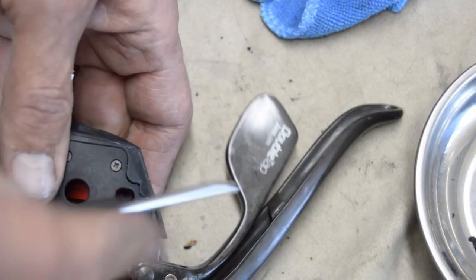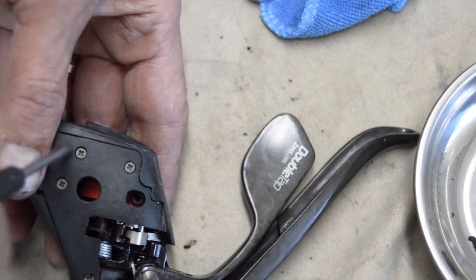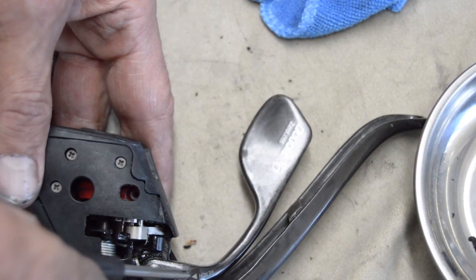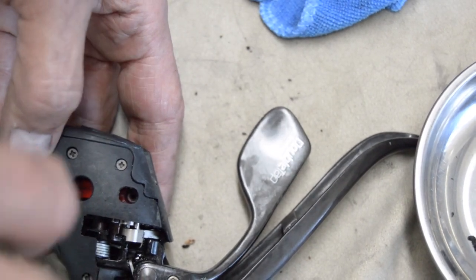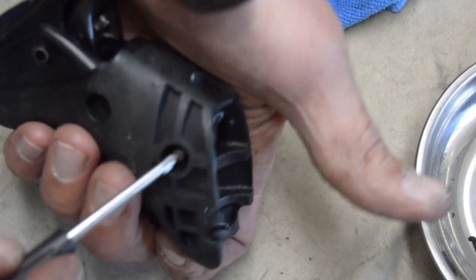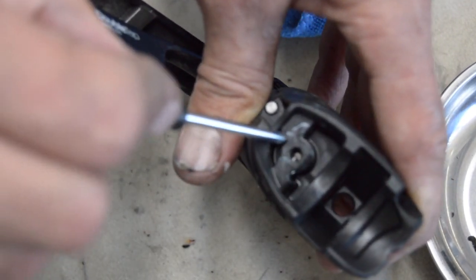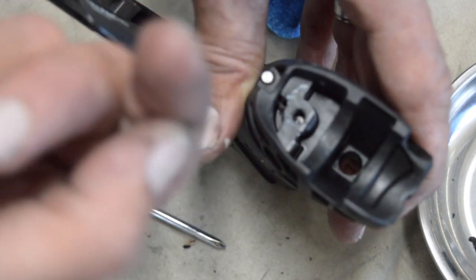You can see on the shift lever that gap in between — that's where we can make our little adjustment for shift lever reach. Get these snugged down, and the other screw to hold that pin in. As I snug that one down, you can see it protrudes just past the pin — it doesn't rest against it, it just holds it in place so it doesn't back its way out.